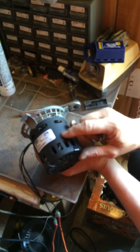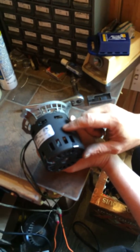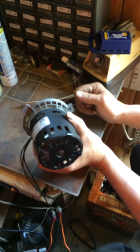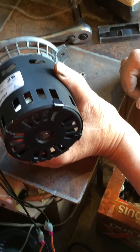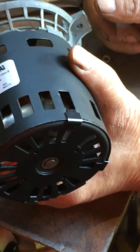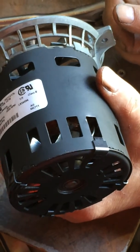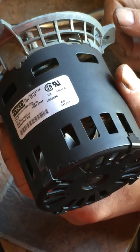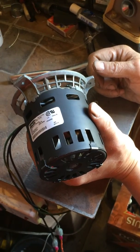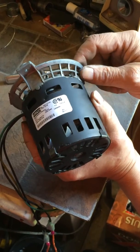By closed frame, I mean the black case on it. This one has a bad bearing in it — as you can hear, it rattles and warbles. These bearings are pressed fit by special machinery. Sometimes it can be fixed and replaced, but if the blower is old and the windings become worn and shorted, then it's really recommended to replace the whole blower.